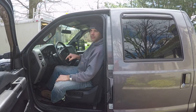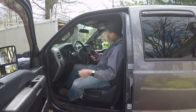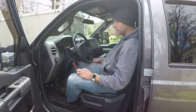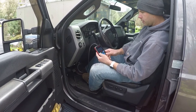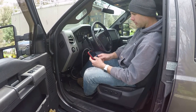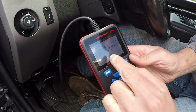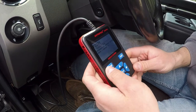The reason why I started looking at the sensor was because my check engine light came on. So I grabbed my scanner, plugged it in underneath, turned the key to the on position. Going through the codes — read codes, current codes: exhaust gas temperature sensor circuit, bank one, sensor two. So that's the sensor we're going to go after today and replace.